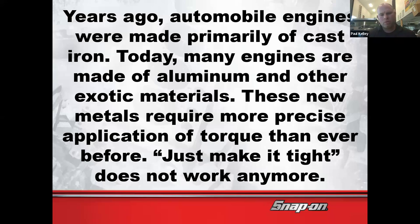And then part two that I'd like to point out is a lot of parts, especially on steering, will have little cotter pins and stuff like that. That's basically a just in case you under torqued it, the cotter pin is going to stop it from falling apart. Because just picture it, if it's something in the steering and it completely falls apart, what happens to the car? Clue, they can't steer. So how do you think this is going to go? You lose control of the vehicle. Right. And that's a safety thing.